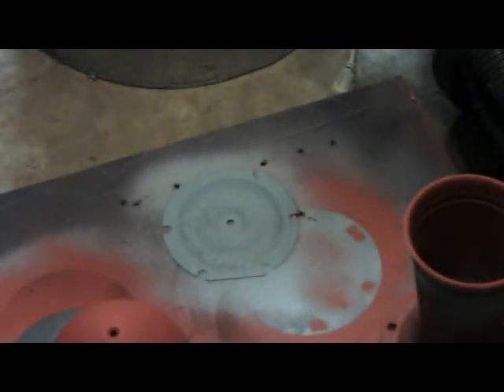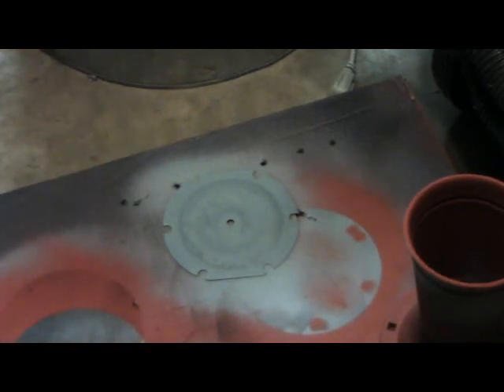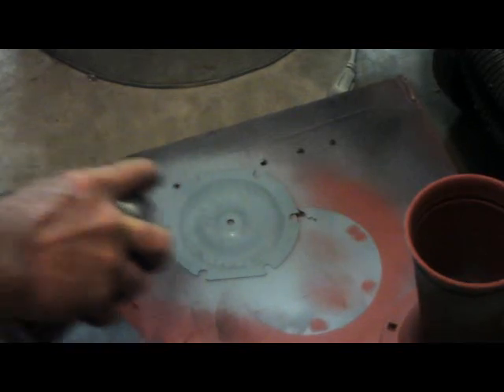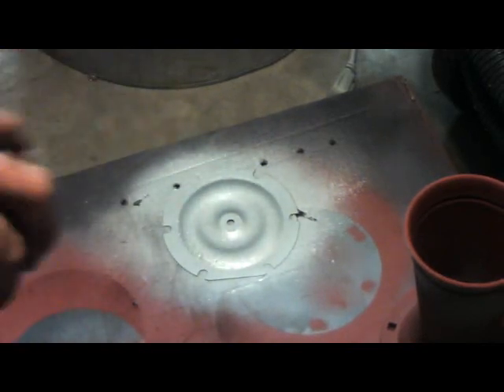I should note that I did take the diaphragm out of the horn. It had quite a bit of corrosion around the outside edge, so in the process of cleaning it up, I wire brushed it all down. I put a light coat of primer on it, and I'm just going to put a light coat of paint on it. I don't want to deaden the sound of the horn, so I'm just going to put a light coat of silver, just to protect it.